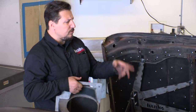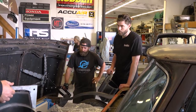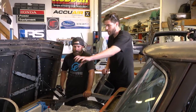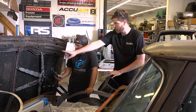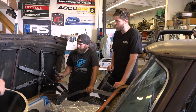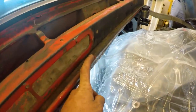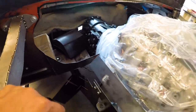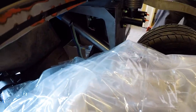It's all off because the supercharger doesn't clear the hood. The front of the supercharger and the bends will sweep down — so the hood's getting cut. It'll land between the center points; this doubler is going to get cut and we can rework that to add stiffness back. There's a little spot right here that needs a notch. The supercharger doesn't stick past this flange anymore — we've got maybe an inch air gap. So the firewall can go right to this; it looks like you'll be able to do just a flat firewall across this thing. We've got the bracket for the brakes mocked up, ready to be on the firewall plane — it's flush. There's some adjustment under the dash, and it's all bolted in, not welded.